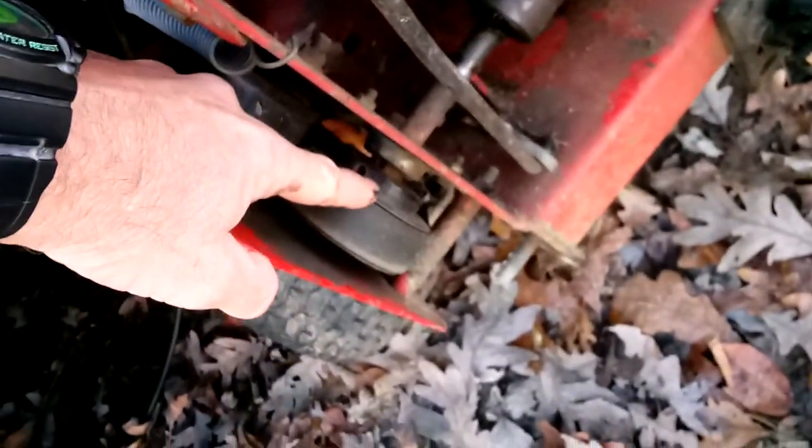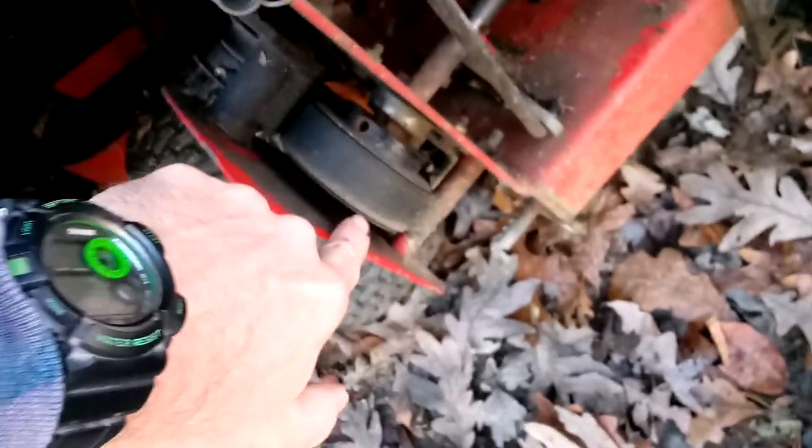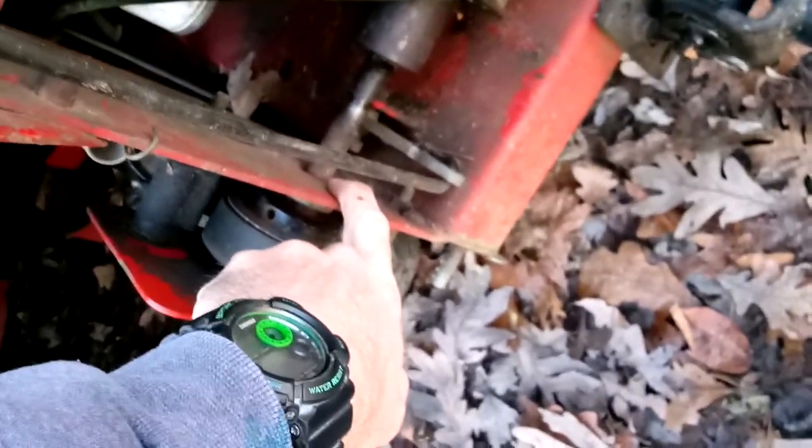It's just barely an intermittent slippage, because it won't fall completely apart, but you have to fix it, because it'll chew through what is called a sheave. It'll chew through this because it's metal to metal, and it'll eat up this thing too. And neither one of these is cheap. This one's like 80 bucks, and this one's like 25 used. So this little ring is about $1.